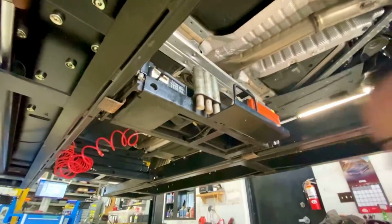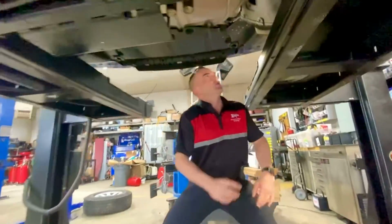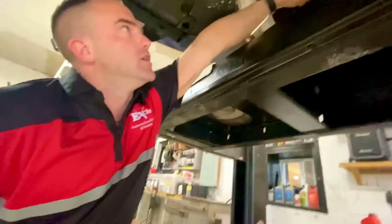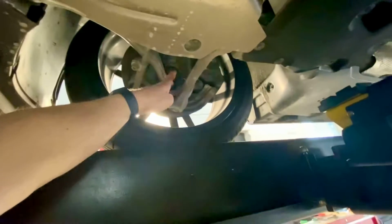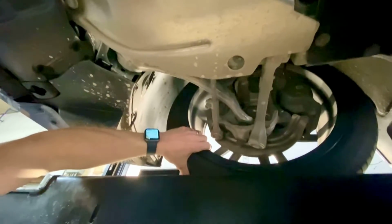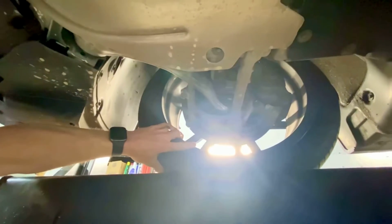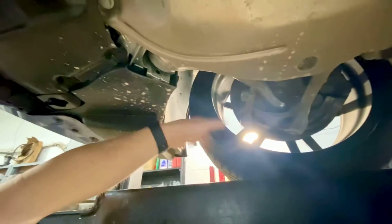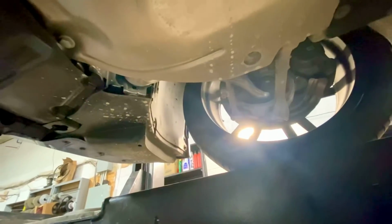Now if you want to come up here real quick and look at the front wheels where you see the axle in the rear, and you look up here in the front of this wheel and hub assembly, there is no axle. Also, there is no front differential. This is why these tires actually free roll. If these wheels were not sitting on this 4-post rack, I could spin these tires freely. And that's why you can tow it from the rear.